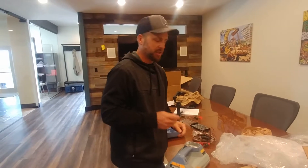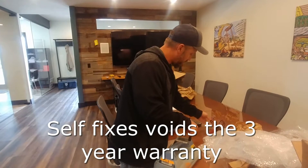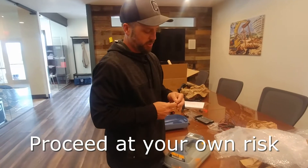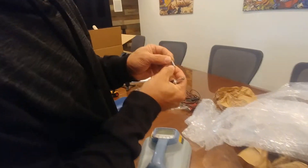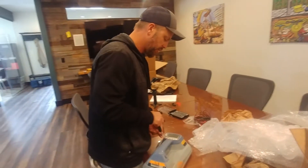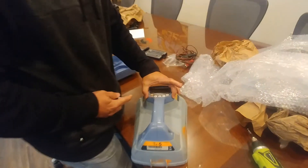The replacement is inexpensive but it is a delicate process. There are about two dozen screws that you need to undo, and you need to use a T9 hex screwdriver — that's what will fit those screws. There are four on the top first; unscrew the two on the front and two behind.